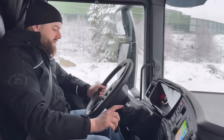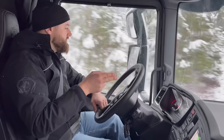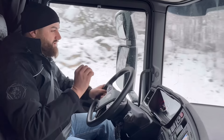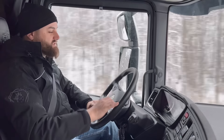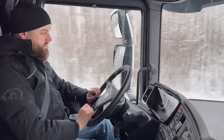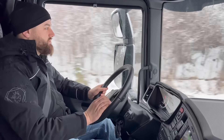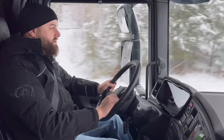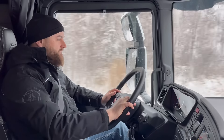We're now going downhill. This one has the automatic retarder. Once we get going downhill, we can give the brake just a one-two tap, and that applies the automatic braking and retarder on my screen to 36 kilometers — and the truck will keep that speed. Right here on the steering wheel we can also bump that speed down even lower, and the truck will automatically start bringing it down without me touching the brake or the throttle. To cancel that, you just simply press the accelerator and it continues on about its day.